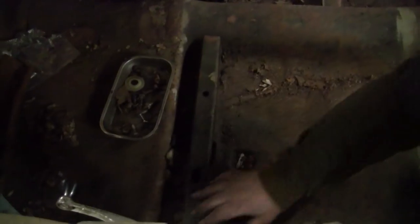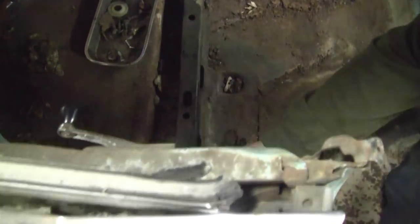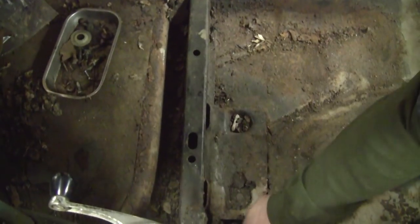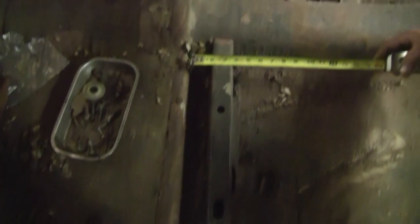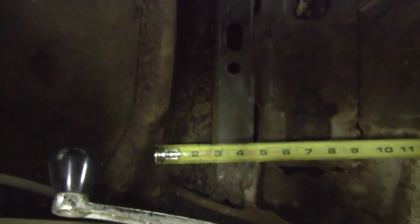What we're going to do here today is take a few measurements. This is the back brace panel of the car, which holds the backside of the floor together, just to brace the side pillars and add reinforcement. We want to take a measurement from our existing floor pan, which curves to the end. We want to get somewhere in the same ballpark vicinity of this top weld — we're not going to get a perfect fit, but we'll get it pretty close. It appears to be about five and a quarter, five and an eighth — actually shorter towards the inside. Five inches I think is a pretty rounded number.